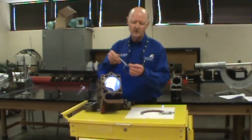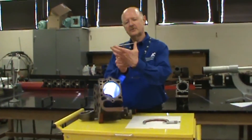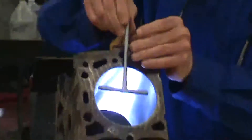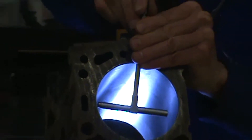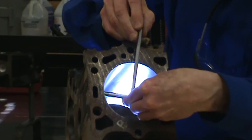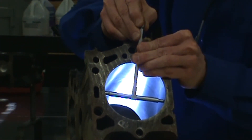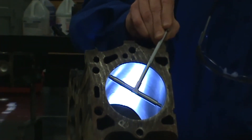To install it we want to compress it — they're spring loaded — so we want to take your fingers and push it in and snug it down gently. We want to place it in the bore at the top of ring travel, which is about a quarter inch down. We want to expand it, hold it perfectly square, then snug it down gently and pull it out of the bore at an angle.